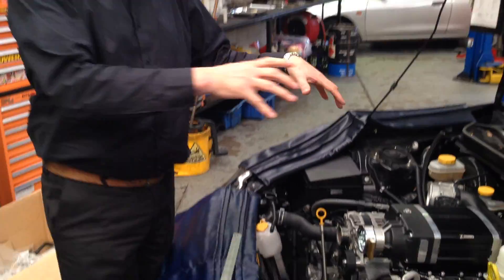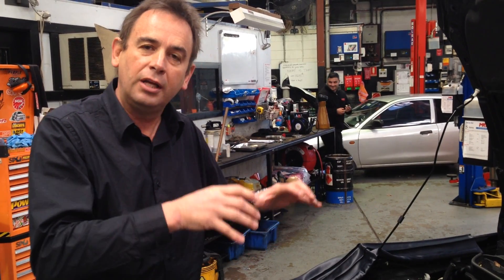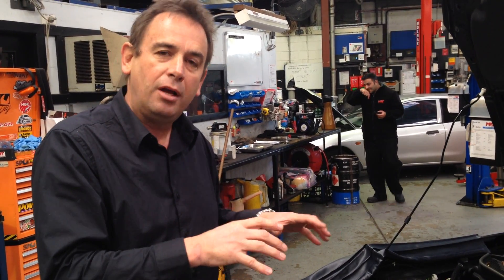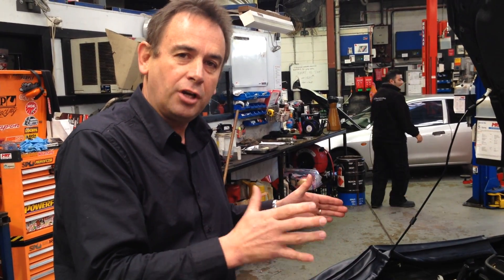What I'm going to show today is the importance of when you sit this assembly on the top of the engine - there is a little bit of tweaking and movement available just to get that blower lined up both forward and aft, and also aligning it slightly left and right. There's not a lot of movement, but there are some things you need to be aware of.